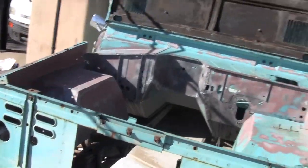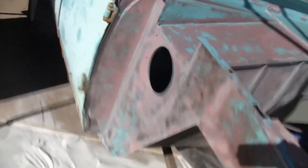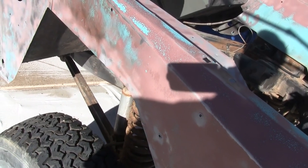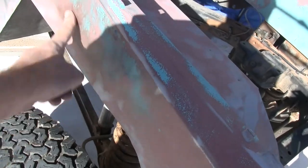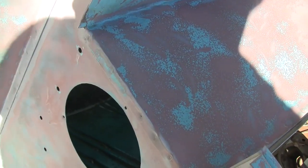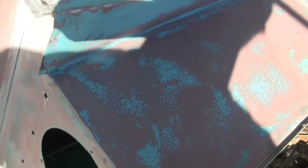This is the end of the first day of sandblasting and you can see down on the ground here — just piles of sand that were contained. Things I have learned from this experience: number one, lighting is important. A tarp, while it's great for keeping sand back, also doesn't let you see very well. So I've got some spots here that are still dark, that have got grease, rust, whatever on them. Other spots still have the body filler from 1968 still stuck in here — did a pretty good job.